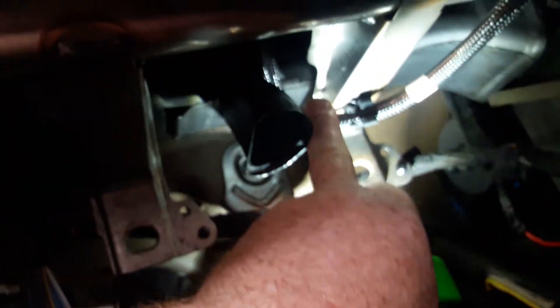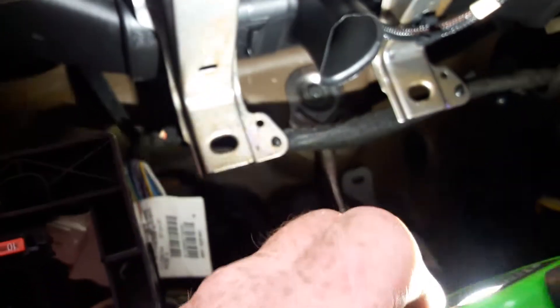I've spoken to the customer about it and he said the light came on last week when he accidentally kicked the glove box. Under further investigation, taking the glove box out, there might be an issue with the wiring up here to the airbag — this was obviously insecure — but then found out it wasn't related to the issue at all.